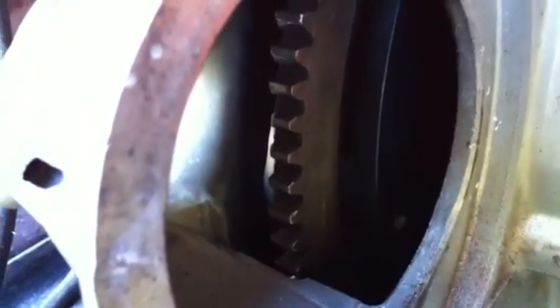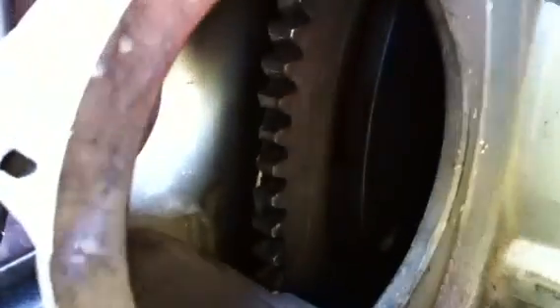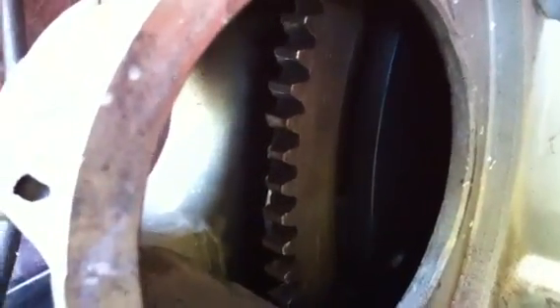Here's another little thing: I put this engine up on the ramps yesterday and just shut it off because I didn't want it to lurch as I positioned it. I always tell people that these engines shut off in one of two places because of the 180-degree crank. It's a little hard to see, but where it happened to stop, you can see right there in the middle — those two teeth are chewed up, because it's a used flywheel.